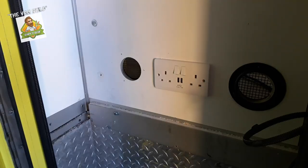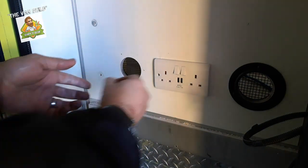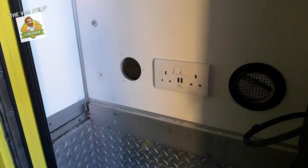I like the idea of having a USB socket — I love these little finishing touches. I've tested the sockets with the heat gun and everything is going okay. We've got a twin socket up there that's live. I needed to power them up because I need to charge the batteries while I'm plugged in. I've also got a twin socket here — cable tied for now — but that's going to be under the bed. If any of you are ambulance drivers and know how the electrics work — every now and again when I'm plugged in, the socket on the side of the van pops out, like if the batteries are fully charged or if I start the engine while plugged in. I'd love to know why — vanbuild@charlieandme.ie.